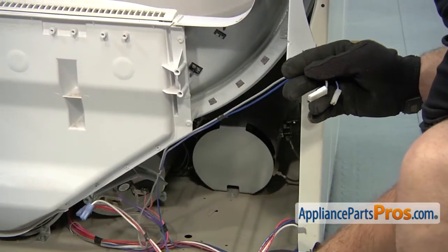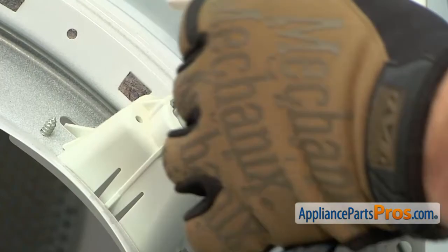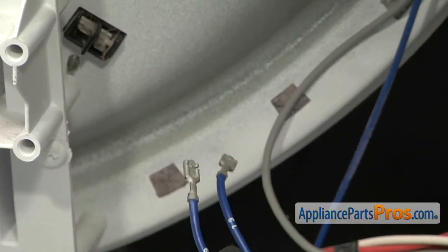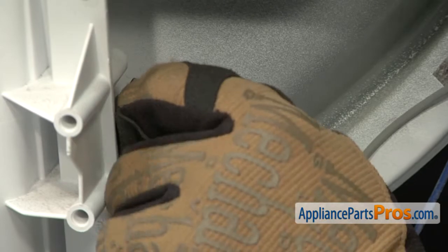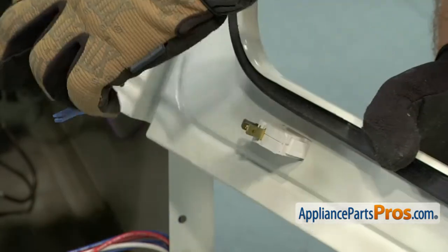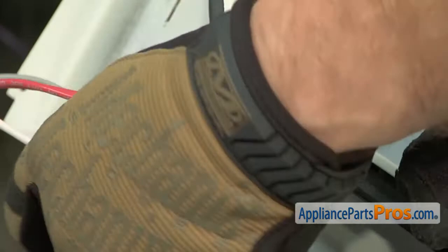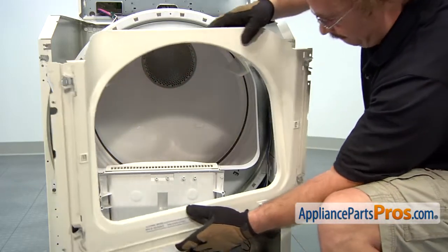Now we can reach down to the bottom and pull the wire harness out. We are going to do the light socket first. Remember it was the blue and the grey, they are 2 different sizes. So we are going to hook those up to the light socket. And then we are going to come down and grab the 2 blue ones that are the same — remember these do not matter where they go, all we have to do is push them on the connectors. Here is the door switch — we are going to put the wires back on now. Make sure you hook them up the same way you took them off. Ours was double red, grey, and white. Now that you have the wires hooked up, we can rotate this panel around and put it back on the dryer.